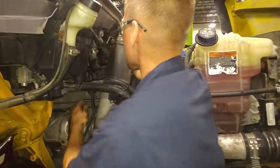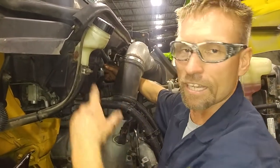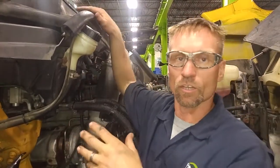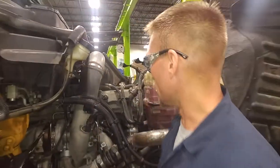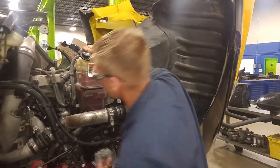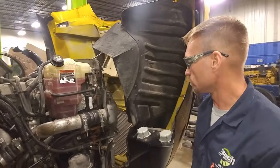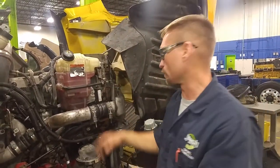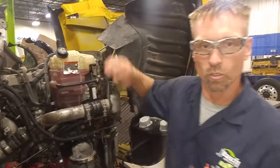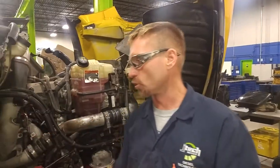Up off the back of the engine there's your inlet right here, and your exhaust coming out of your heater core. The heater core is another small type radiator located in your air box, which blows heat when you select the heating controls into your cabin. There's also an engine oil cooler located up front here in the middle, with a feed line coming right off the top through a manifold, which feeds through to help cool the engine oil. The coolant also flows through the air compressor, which controls your air brakes and air controls on the truck.